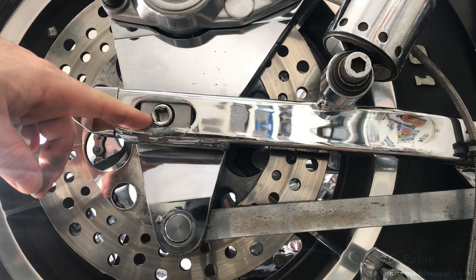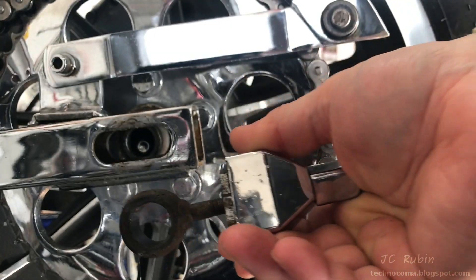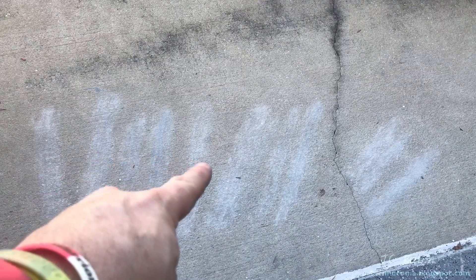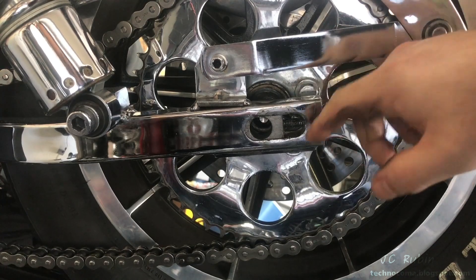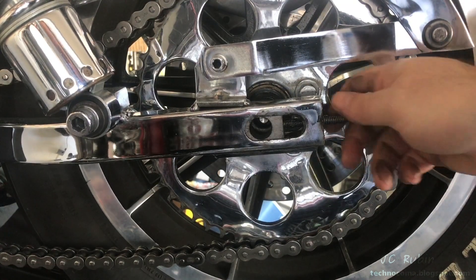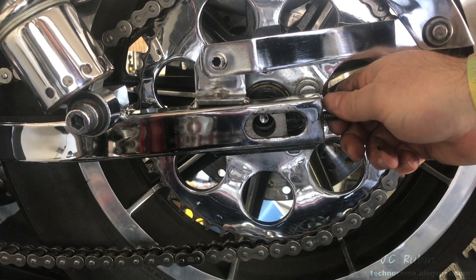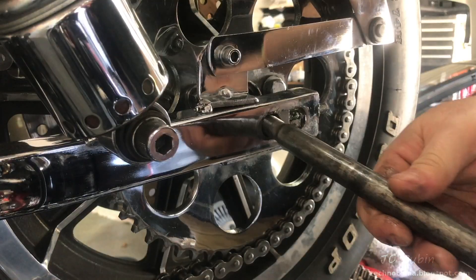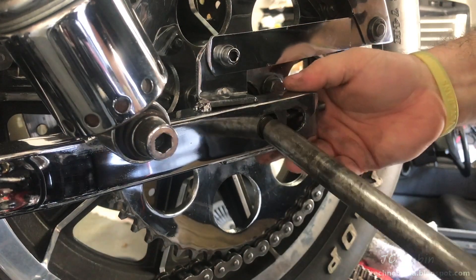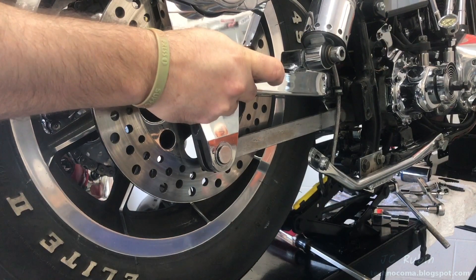I'll put this off to the side. We can see the end of the socket extension just inside the wheel and the other side just sticking out. This allows me to remove the old unit, which is really rusty and probably not long for this world. The new one required a little bit of sanding on the driveway to address some imperfections you'd find in this older swing arm. The wife is on the other side jacking it back up into position. This allowed the cleaned and greased shaft to be reinserted back into the unit without any issue. As it's inserted, the socket extension is slowly removed.